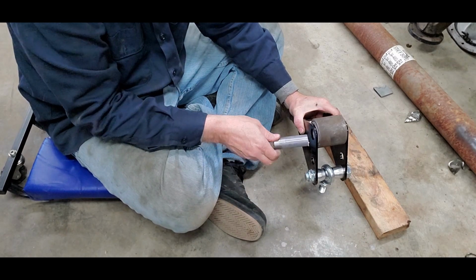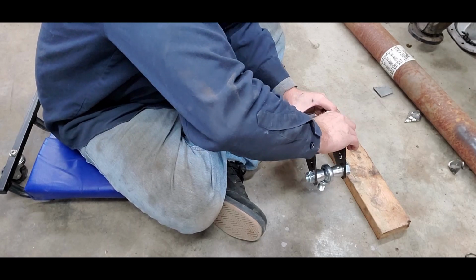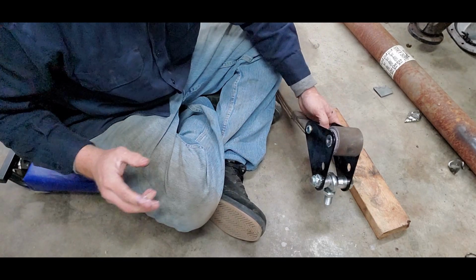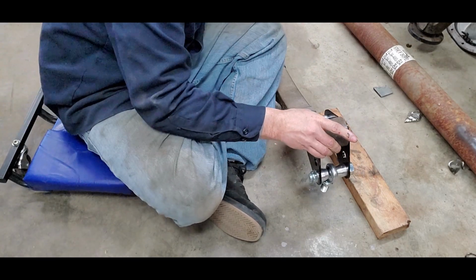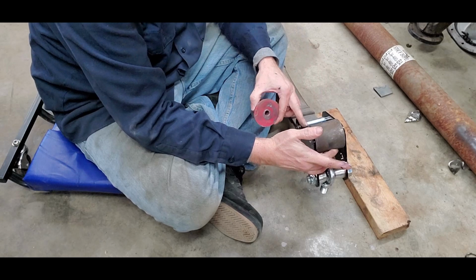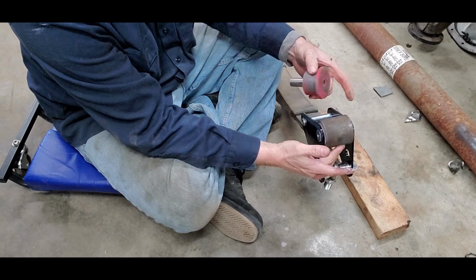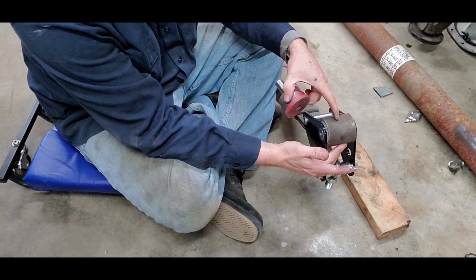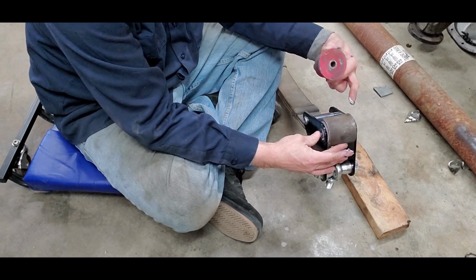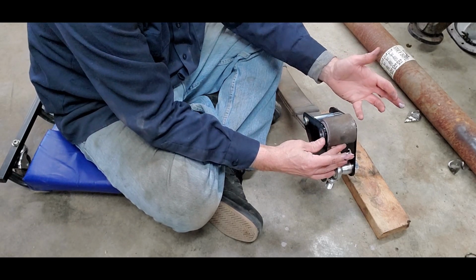So now our bar goes right in there, and it helps locate this bracket. And of course, in case you're wondering, our old bushing has this lip here, and the lip is about the same width as the thickness of this bracket here. I don't know if you can see that on camera, but it eliminates that. This inner aluminum bushing is flush with the spring. Then this little sleeve in here is the exact width of the pocket where the spring sits. And then of course everything rides on the inside of this guy here.